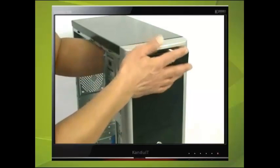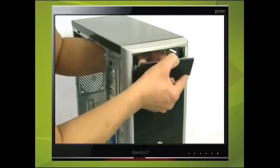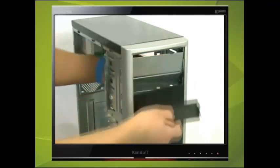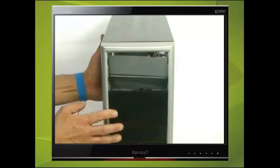To fit the DVD-ROM drive you will need to remove one of the plastic panels, and behind this you may find several metal panels. Carefully push one of the plastic panels out from within the case. Removing a second plastic panel will give you better access to the metal panels. Next, one of these metal panels will need removing — in this instance there are 4, each attached to the other by small lugs.